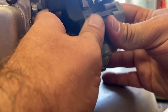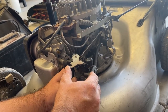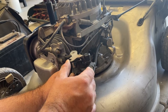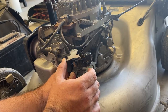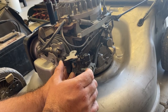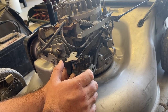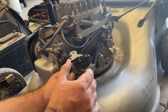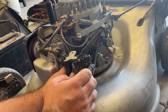To explain how these work, this goes on to the carburetor just like this. You can see where the holes line up, and then as this heats up in here it presses that forward — just like that. You can see it opens up the choke. The whole reason behind that is when you shut your mower off and it's all warmed up, you don't need to choke it again — at least you wouldn't need to if it was manual. So that's what this is doing for you: it's automatically setting itself where it needs to be so you can restart your mower when everything's all warm.